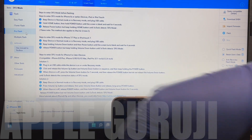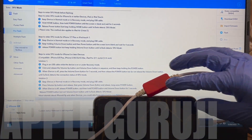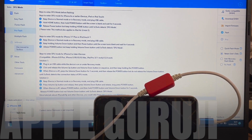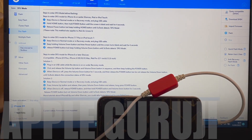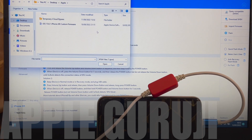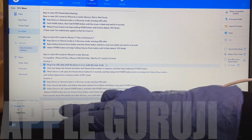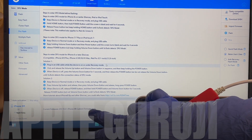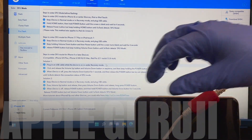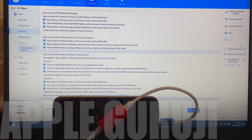You can verify the status which says DFU mode. Now click on the import firmware option. Select the iPhone XR custom firmware package and click on Open. You can see that the current firmware loaded is iPhone XR custom firmware. Make sure to use DCSD serial port lightning cable only. Now select the retain user's data option and then click on the blue colored flash button.